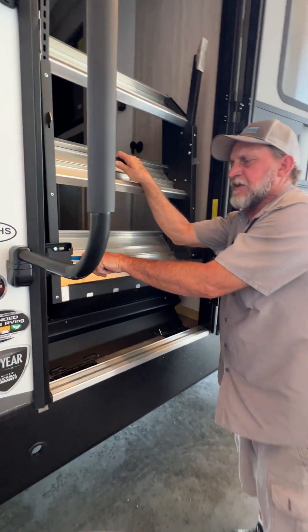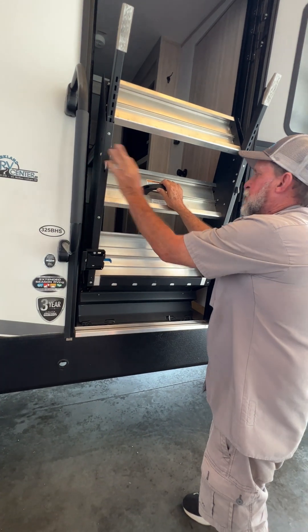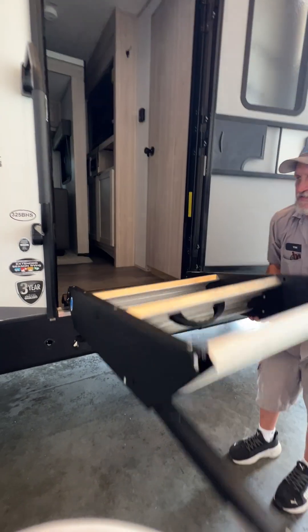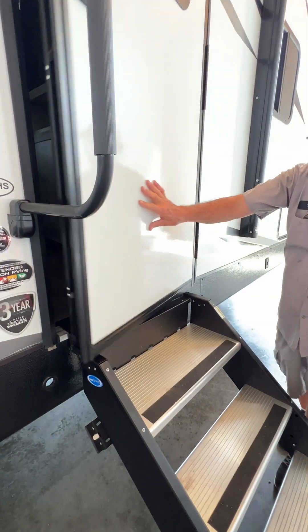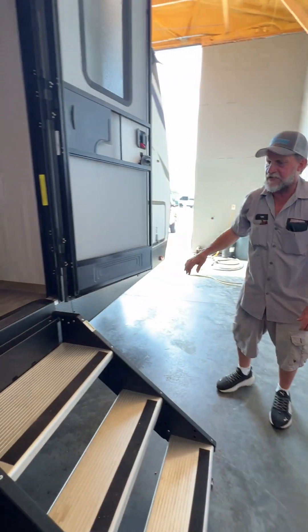Here again we're going to pull the blue handle on the left-hand side — it allows the steps to come loose from the door frame. A little push button underneath each one of the legs, with 15 to 18 slots in the legs for adjustment. The main thing on the steps is it has to lay flat in the threshold so that the front door fits over the top of it properly. We're going to open it right back up and step to the inside.